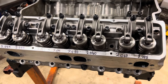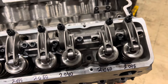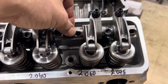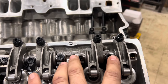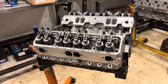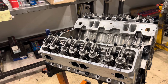If I judge the spacing from here to here, it's definitely not going to work. It's not the right shaft. I don't know how they mixed this up, but you can see it by eye on the intake side because the rocker offset has a bigger space in between. Even if I want to flip it around it's still not going to work. Just another day in the high performance world — everybody thinks you buy the best brands and everything just goes together and works great. It does not mean anything.